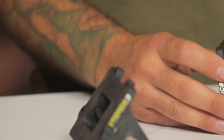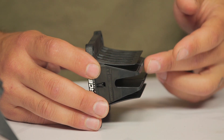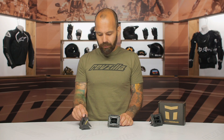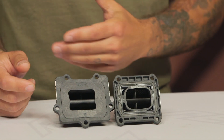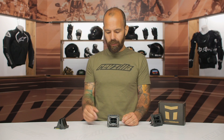Two-stroke and four-stroke engines are just air pumps — the more you can move air and fuel through these engines, the better performance you're going to get. So having more reed tip area is really going to improve the performance of the bike. When we take a look at the interior wing compared to the V-Force 3, you can see it has been reduced quite a bit, allowing air and fuel to pass through with less turbulence and more efficiency versus the outgoing model. The three is still a great option over older stock bike reed valve systems.